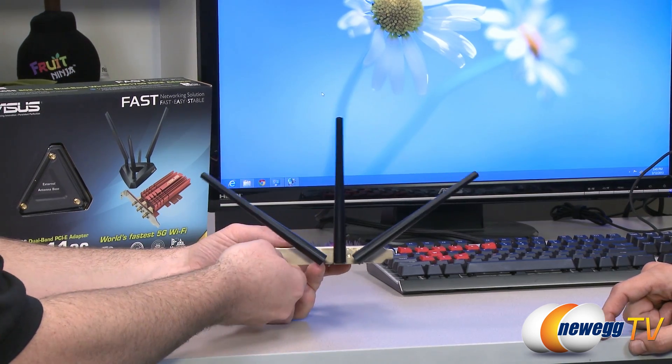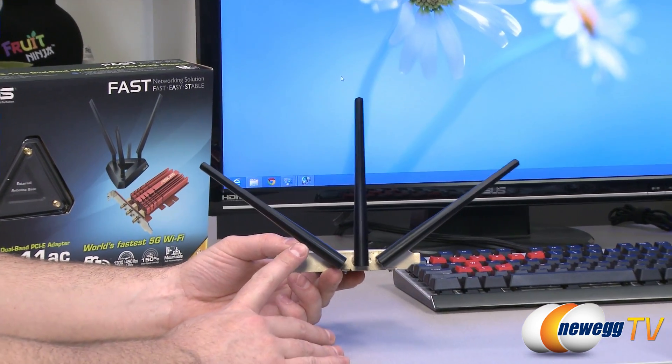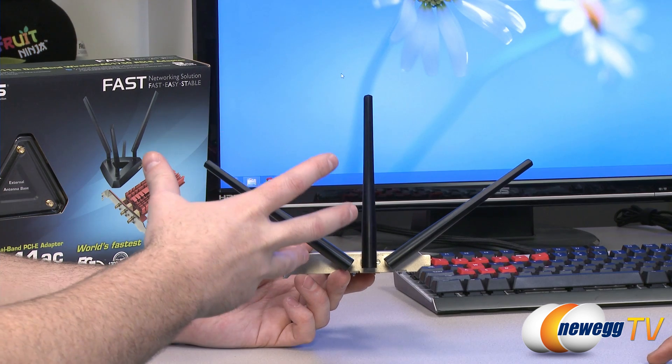It's basically going to allow you to get the fastest speeds possible using 802.11 AC today. Just a quick comparison: going from 802.11 N to 802.11 AC — with 802.11 N, if you had a three-antenna solution, the maximum theoretical bandwidth per antenna was 150 megabits per second, and you could aggregate those together. You'll see that labeled as 450 megabits when three antennas are maxed out on 802.11 N. On 802.11 AC, for three-antenna products, you'll see 1300 megabits or 1.3 gigabits per second advertised. The two-antenna solution comes in at 867, and the single antenna at 433. So you're moving from 150 megabits per second per antenna to about 433. Let's talk about some real world performance.